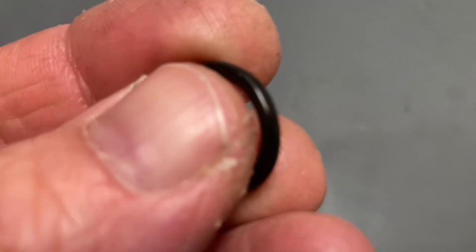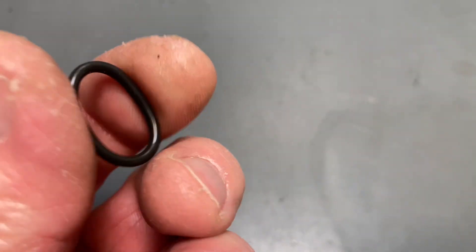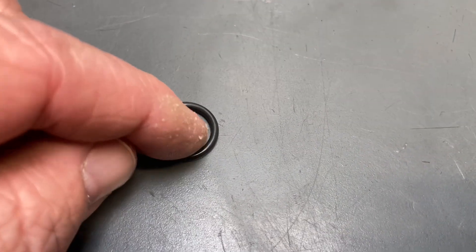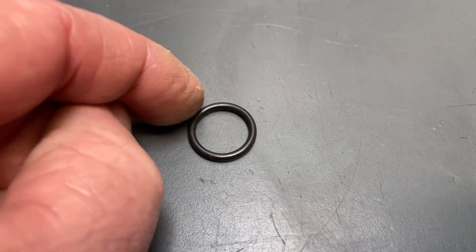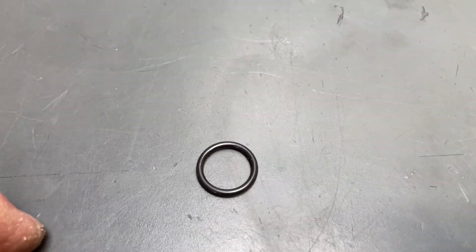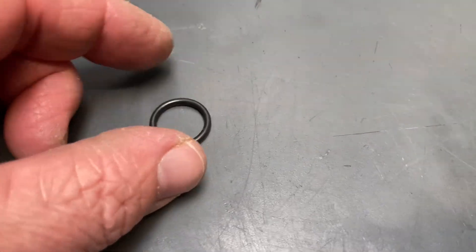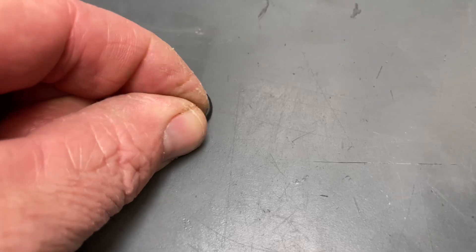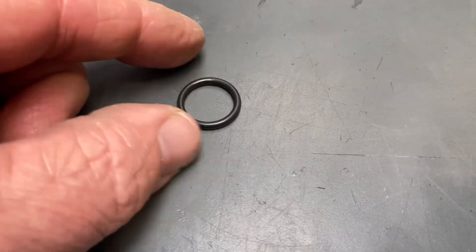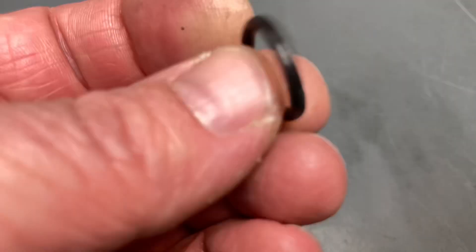If you made it to the end, that's the crankshaft sensor O-ring, and it's actually not hard or bad at all. Toyota quality — what I believe is the cause of the leak. When an O-ring's on a sensor and people tighten it up, it can twist the whole sensor sideways, putting more pressure on one side of the O-ring and squashing it, leaving not enough pressure on the other side. So it's important to have it all centralised. Same as those caps that go in the block and any O-ring situation — it could be a bypass pipe on a water pump, stuff like that. I've pulled them apart before where we've had leaks on other makes and models and found it squashed on one side really badly and not on the other. So it really needs to be central when it goes in and held in position when you nip it up. Last little tech tip at the end of the video. Thanks for watching, hope you liked it. Catch you on the next one.